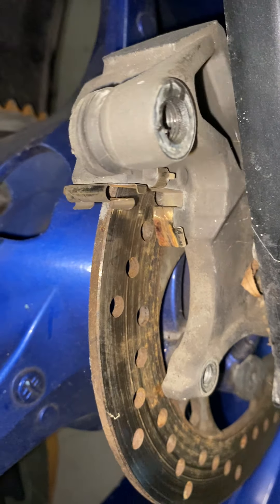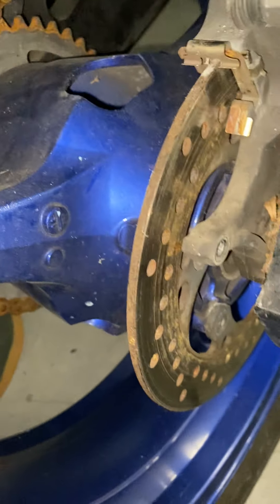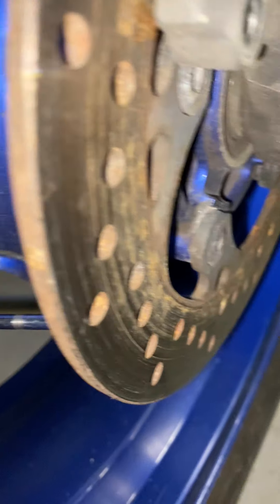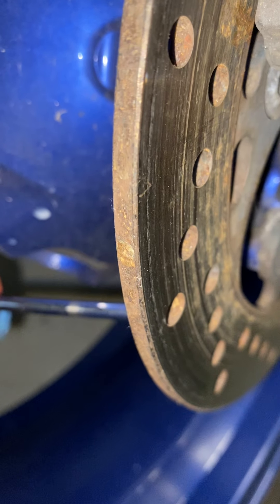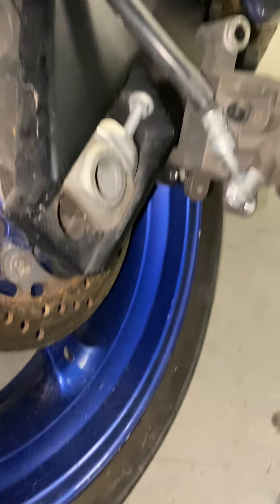Now, checking the rotors. You take your two fingers and move across the rotor — if there are grooves on the back or front you'll definitely feel it. But if you want to get a bit more thorough with the inspection, you can use a screwdriver tip, a pick, or anything like that and drag it across. Once that tip doesn't fall into any grooves, that's good in my book. Same for the rear — you drag it across, nothing, you are set.